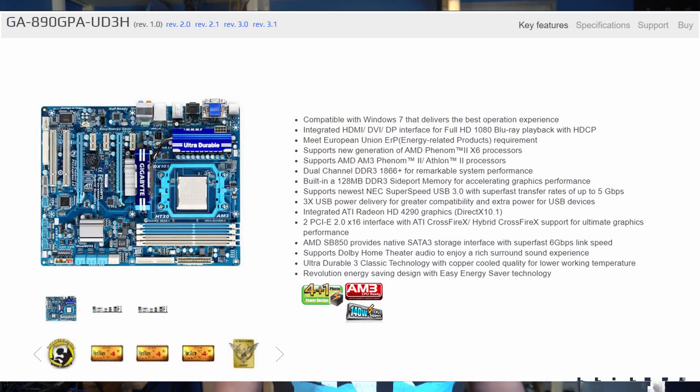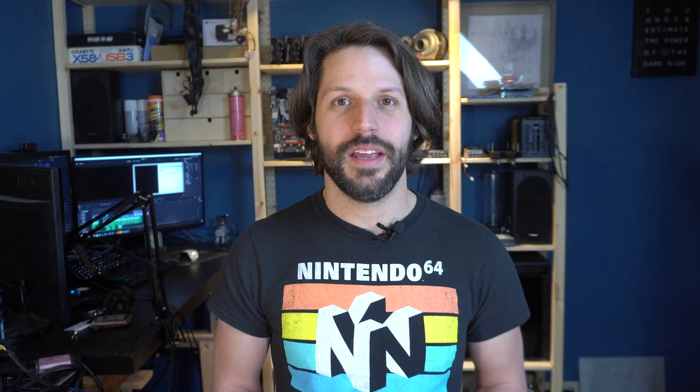In my experience, your best bet is going with an AM3 motherboard with an 800 series chipset. Still, that's no guarantee. There are plenty of stories online where people had a CPU unlocked on one motherboard, upgraded later, and now it was no longer unlockable. So essentially, you have to play the silicon lottery on the CPU side as well as the motherboard. That's quite a big pill to swallow.